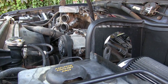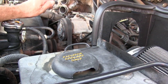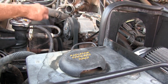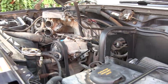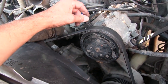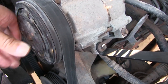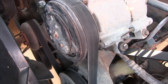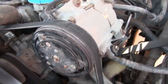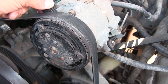What I really need is the air conditioner working. This is the compressor, this is the clutch. When you flip the switch on inside, this has an electromagnetic clutch — it should engage and the whole thing should spin. I checked it out when I first got it — I got power here, so this should engage and catch and spin the whole thing with the pulley, but it's not. So I'm going to disconnect it and run a couple jumpers over to the battery to see if I can activate this manually, because it should come on.